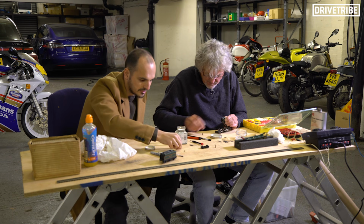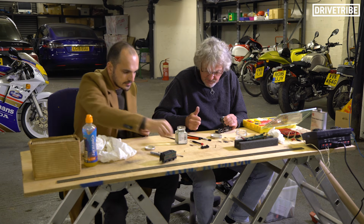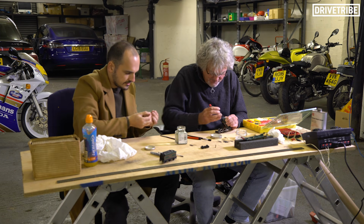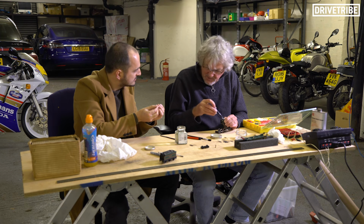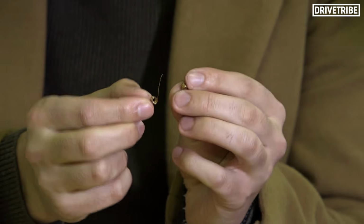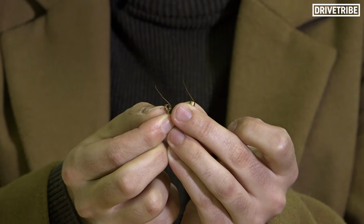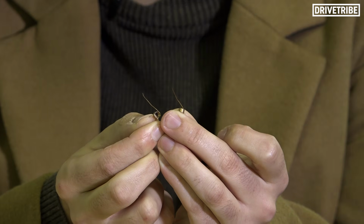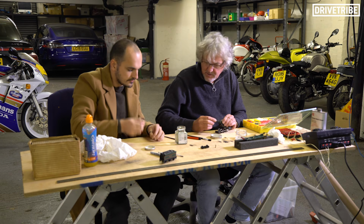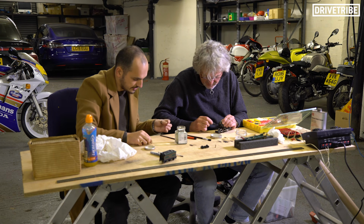These springs were a bit of a bugger last time, weren't they? Yeah, those springs are escape artists. You have to be very careful. I also don't have any spare ones. Do they conduct anything? Do they need to be clean, or are they just placeholders? Those ones are placeholders. I was going to say, because they're a wee bit scummy. Sorry, no, the ends of them do need to be clean, where they go into the brush, so they're worth a little rub with wire wool, if we've got some. Or you can scratch them clean with the... I can use the brake cleaner on those. Yeah. You can, right?